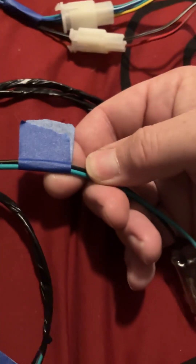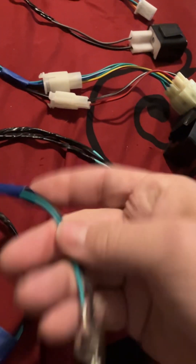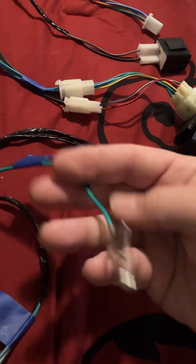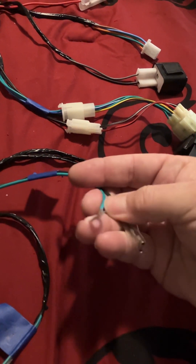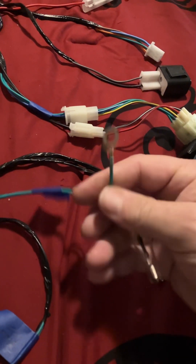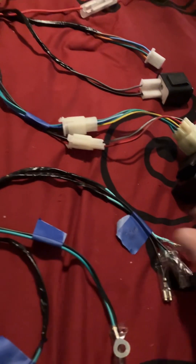This here I labeled 'big coil' — this is your coil wire setup. For this I'm using a Nibby performance coil because it has the exact same terminal connections. It's one terminal for the hot, and red or yellow goes to green to the ground — to the actual frame — and those are your coil ends.